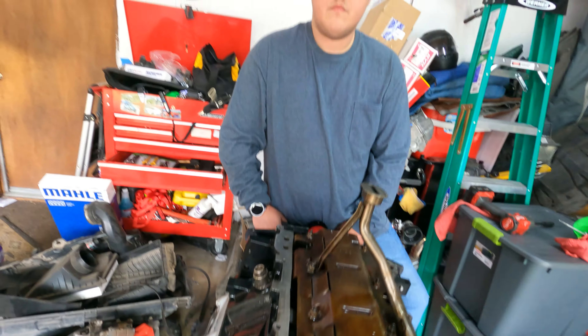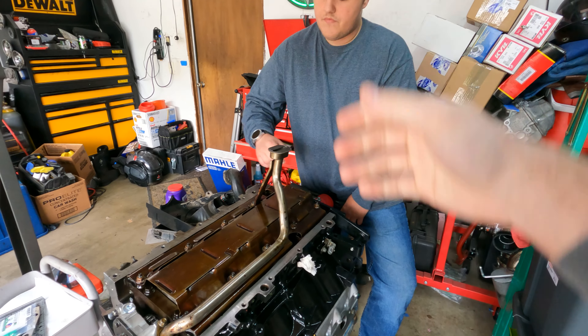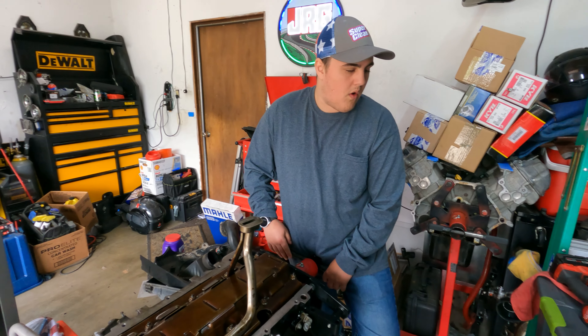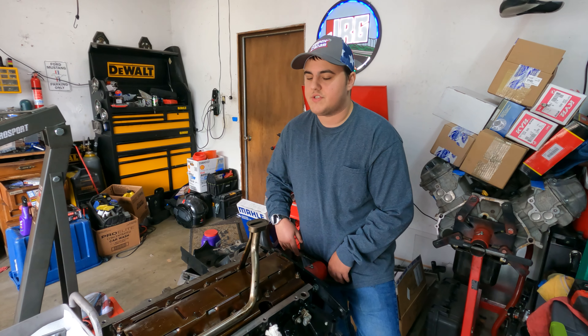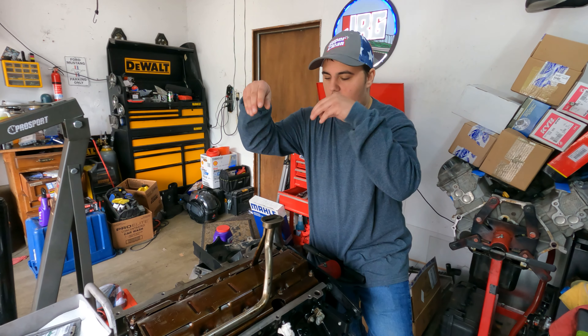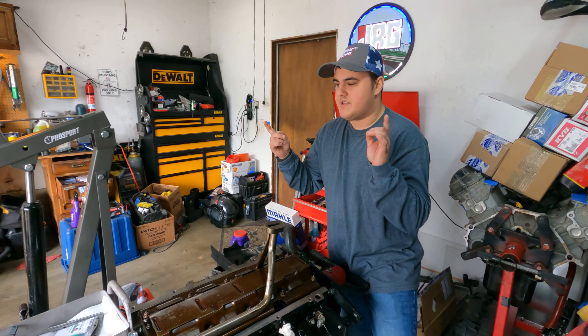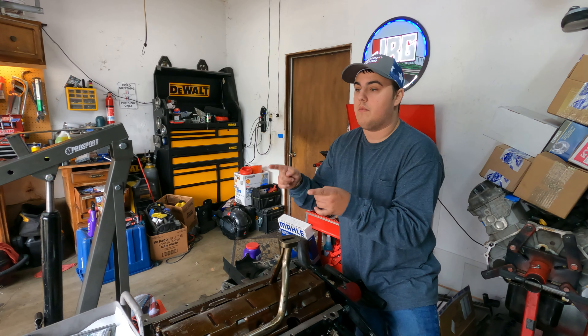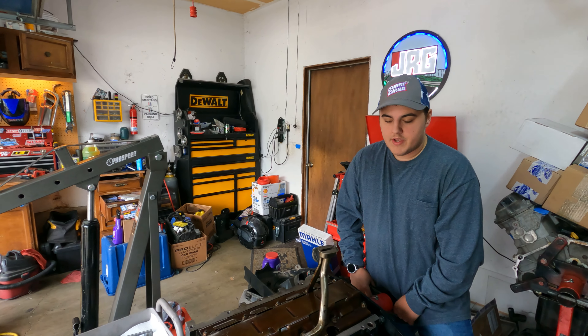The knock sensor all it does is record vibrations in the motor. So if you drill a hole and connect it, it'll work. Traditionally this third gen engine has its knock sensors in the valley cover — it has two knock sensors that go down in it and they have one wire each. And that's not the same kind of knock sensor that this truck has. So it's entirely different, and that's why we're doing this.